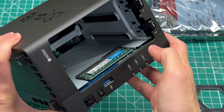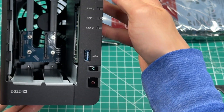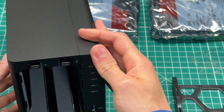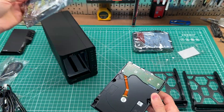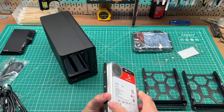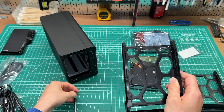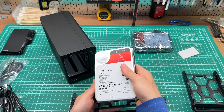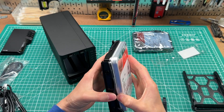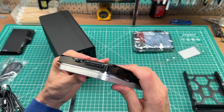You can also see the drive connectors at the back of the device, which is useful to pay attention to so that you don't try to put the drive in upside down. I also bought two 12TB Seagate IronWolf drives that are both listed on Synology's website as being compatible with the DS224+. One of the reasons I went with the 224 Plus is because it supports hardware accelerated video transcoding — not all Synology devices support this, so it's super important to check if the one you're considering supports it if you're planning on running Plex.